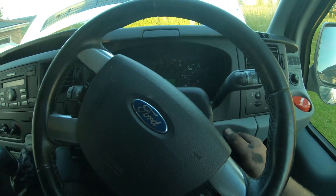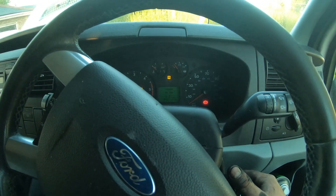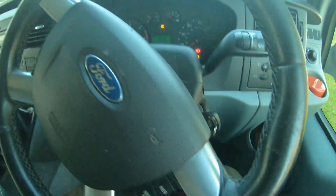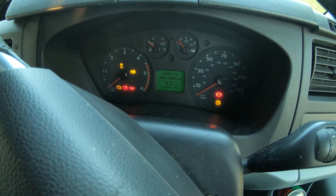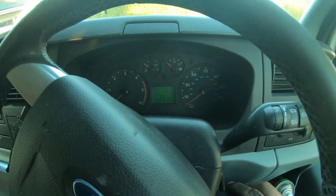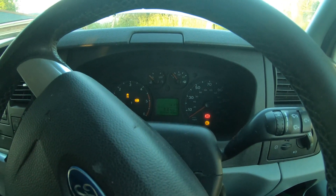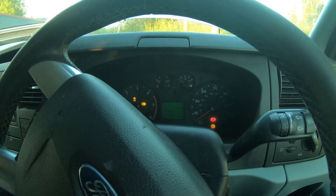I'm inside the van now. Every time you put the ignition on you've got this annoying bleep — it's saying 'service oil now'. The way you reset it is: put the ignition to position two, so two clicks, then press down the brake pedal and the accelerator at the same time and keep them pressed. It'll come up 'service oil reset complete', then you release the brake and accelerator. Ignition off, then start it up and it's gone. Just depress the brake and accelerator together, hold them down until it says reset complete, then release and the job's done.